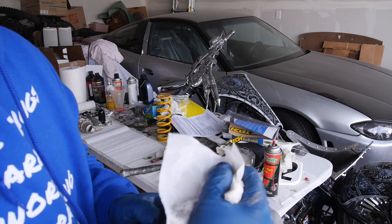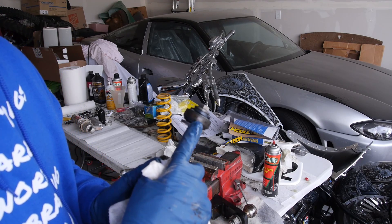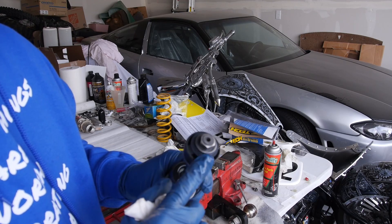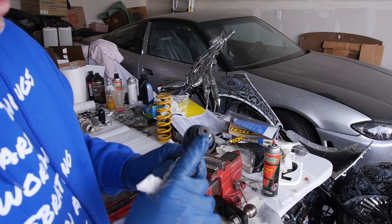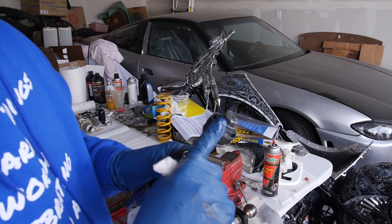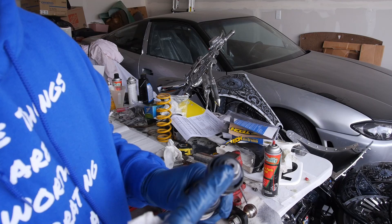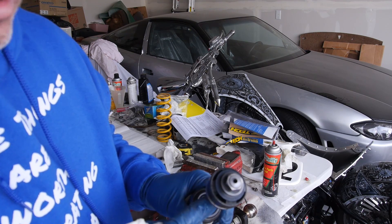It's technical and it's complicated — you mess around a lot and have a lot of shim stacks you don't like until you finally get the one you do. So what we're going to do next is remove this. This nut right here is threaded in there, and it bolts this whole thing together and holds everything on the shaft. At the factory, they don't want that nut to come off, so what they do is stake the end.